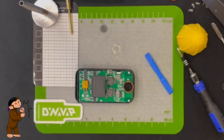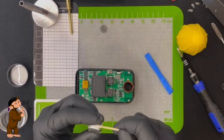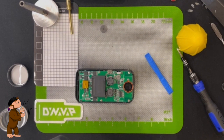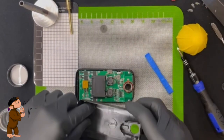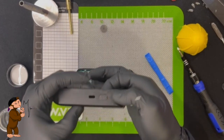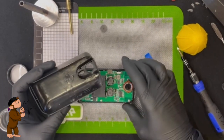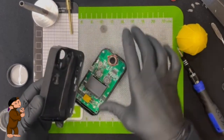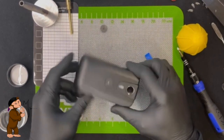As I said, I'm going to wash this little cup real quick — wasn't really expecting that to be so dirty. Alright, nice and clean. We're just going to drop that back in, take the power button, make sure the power button goes back in the right slot and in the right orientation. And this is kind of the tricky part — you've got to kind of hold that thing as you fit it all together. I like to do it like this and just clamshell it.